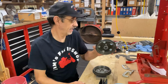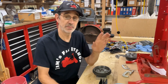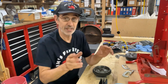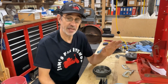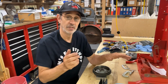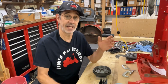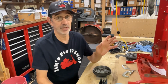I did this on my old 33-inch where I had two pedals. One was supposed to be the clutch and brake, and one was just supposed to be the brake. So I changed it kind of like a car. The left pedal was strictly the clutch. I took the brake arm out. The right pedal was the brake, but it actuated the band brake on the opposite side of the chain case, which they don't put in anymore.